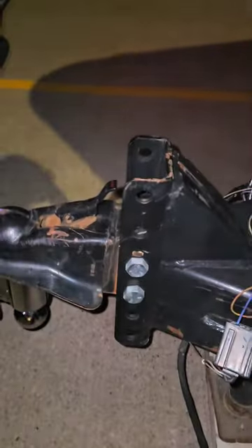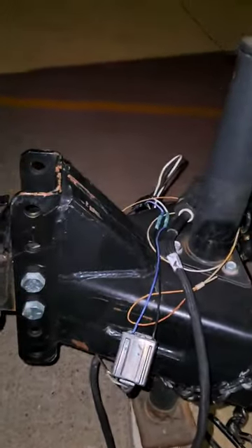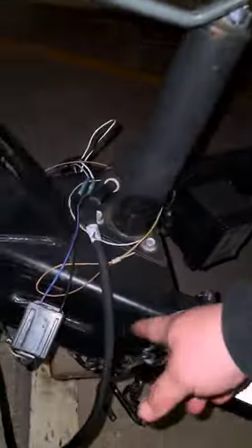Some of you have never hooked up a trailer, so you get a little class on that. Keep cranking this till it's above the ball. Once you're clipped in like this, you got chains, and they hook right into here. So you take this one, put it in here, and then you take your other one that's on this side, cross them — see? That's all you got to do.